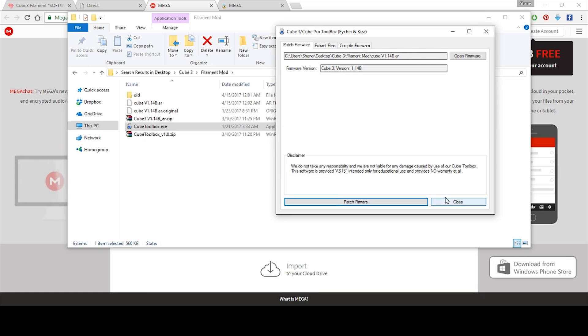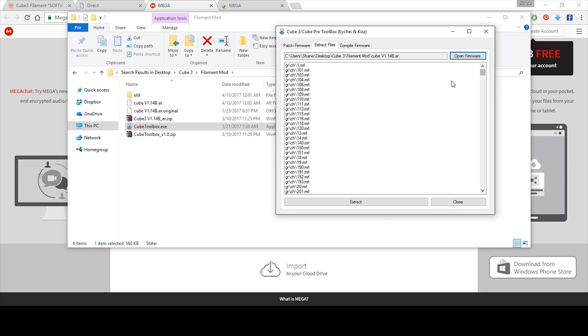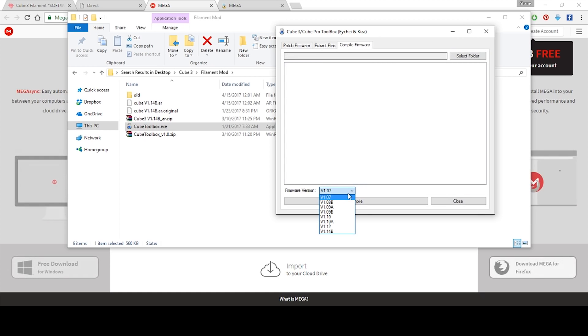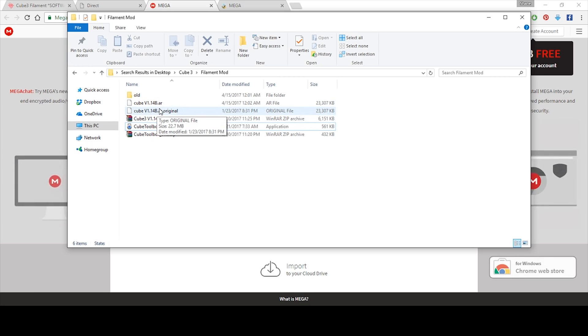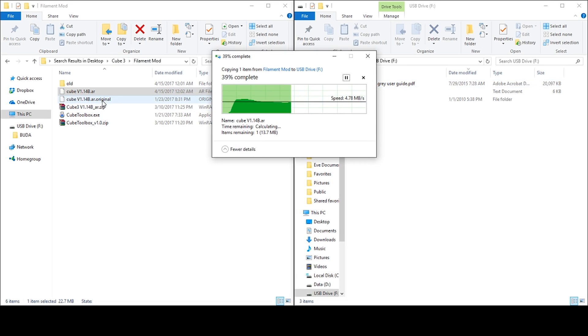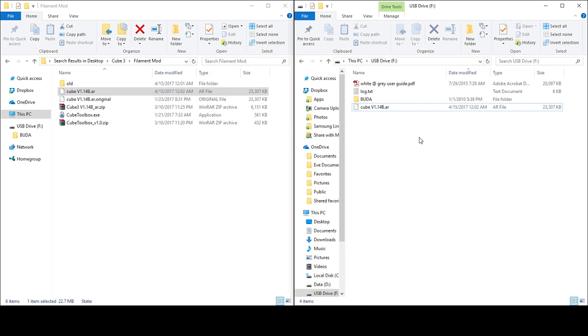It took a second. That's done — you can close this out now. If you want, you can open the firmware itself and look at all the information, and you can compile new firmware if you're so inclined. We're just going to use this as it is. Now insert a thumb drive — the Cube 3 comes with a 3D Systems Cubify little thumb drive. Slip that in, and we're going to put the firmware on it. On the left is my folder, on the right is the USB drive. Copy over the modified firmware — not the .original, that's the original Cubify version — and there it is. Now let's go to the printer and get this installed.